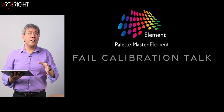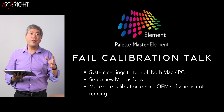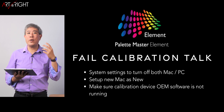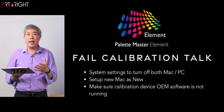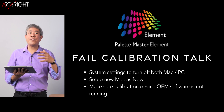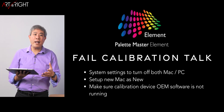Let's talk about calibration failure and some common themes I've been seeing recently. Whether you use a Mac or a PC, there are certain system settings you need to turn off. This is especially important if you have a device with a built-in camera — for instance, an all-in-one device such as an iMac, an all-in-one PC, or any laptop. It's crucially important to turn off settings that automatically adjust the display brightness.